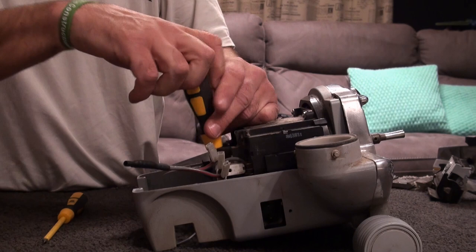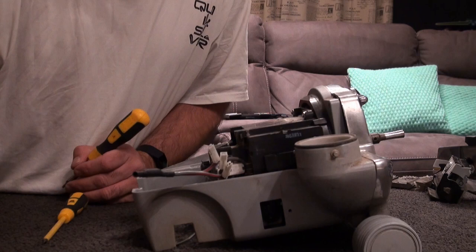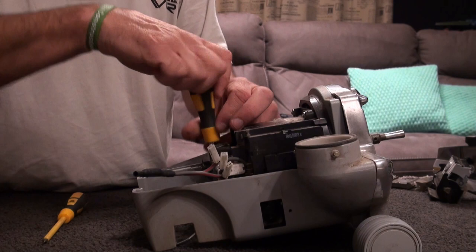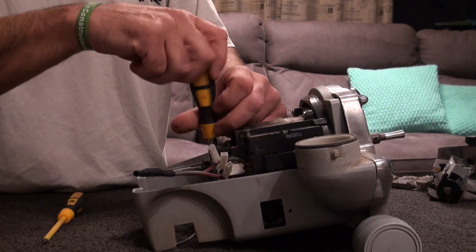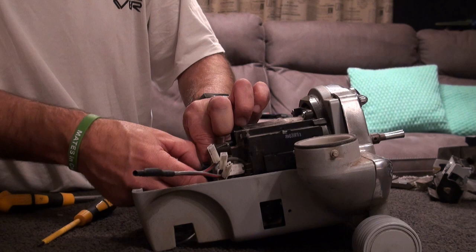You've got two screws with washers on, which obviously go in the top here, which we'll just put to one side. Again, I'll put those with the long ones because I know where the long ones go anyway. But again, if you're not sure, just get a bit of cardboard right where they've come from, or you could even put them back in the carcass once you've took it apart or you're cleaning it. Okay, so just take that earth strap out, which is there.